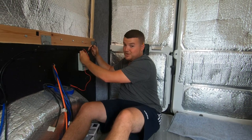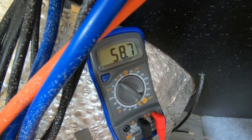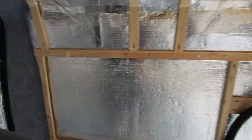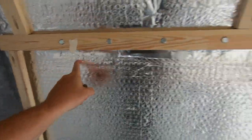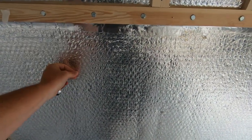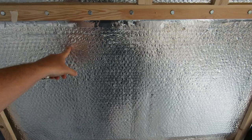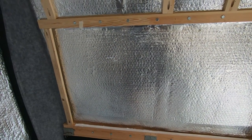Numbers are coming in — 58.7 volts, if that's a volt. So I'm happy with that. I've just popped back into the van. What we're going to be doing today is cutting out the recesses and making them deeper than they were previously. I'll be taking off our reflectix all the way along, trying to preserve it instead of buying another roll, and doing a big rectangle. We've got 50mm Kingspan behind — I'm sure it's 50mm on the walls. We're going to change that to 25mm and see how deep it goes.